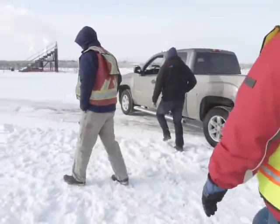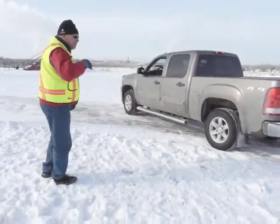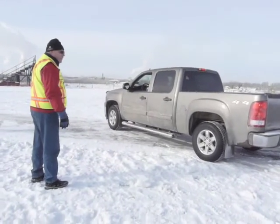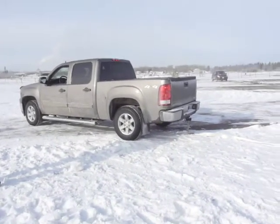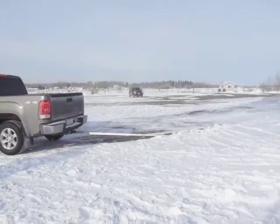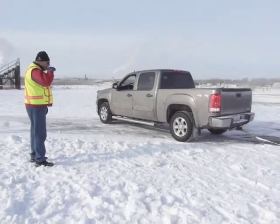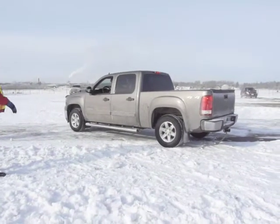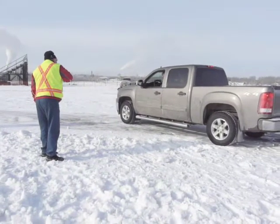What you want to do is move up — make sure you're in four-wheel drive — move ahead really slow until you take up all the tension in the strap. There you go, so you know where it is. Now you're going to back up about three or four feet — you're going to have to judge that. Now go into drive and accelerate, take up all that tension, and apply the brake once you stop.